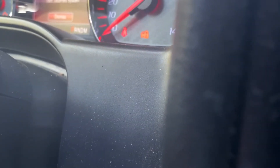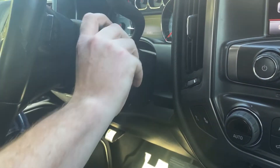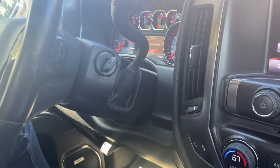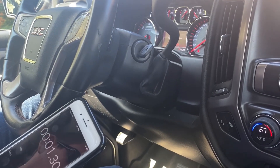So we're getting close to our 10 minute mark — we're actually at 9:50. So we're just going to keep an eye on this security light here; we're waiting for that to go out. As you saw there, it just turned off. So now you want to take your ignition and turn it to off, turn it back to on, leave it back on, and we're going to do the exact same thing. We'll go ahead and reset our timer and we'll see you in another 10 minutes.